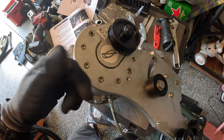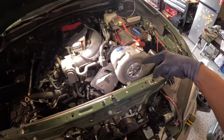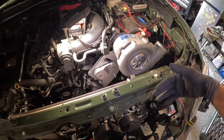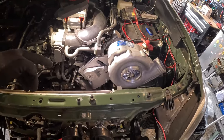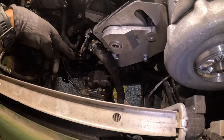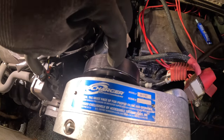Got the pro charger and bracket pretty much all in. When I was putting the whole assembly in, I kind of routed the belt on the pulleys loosely, lined everything up, got all the bolts in, and then started from the crank to run the belt. They have an actual diagram for how you need to run it — just a quick note: the back of the belt is always on the smooth idlers, and the ribbed part is always on the ribbed pulleys.